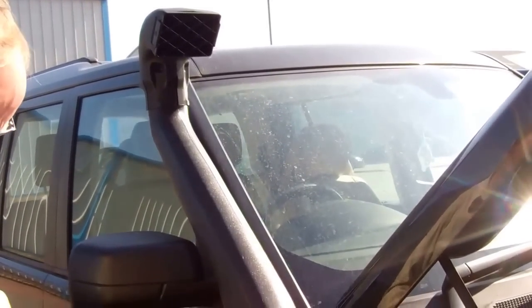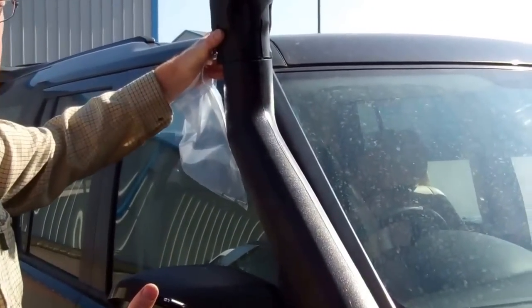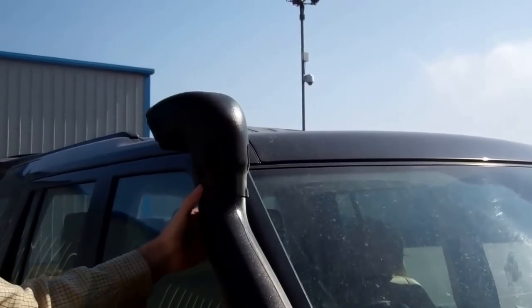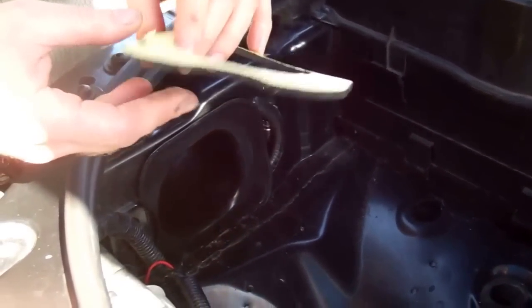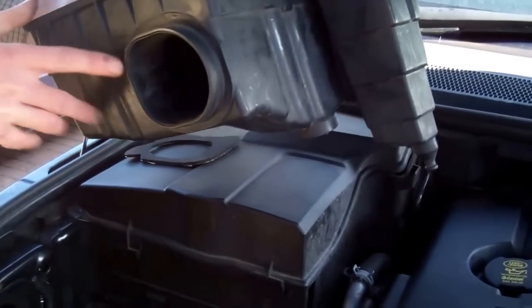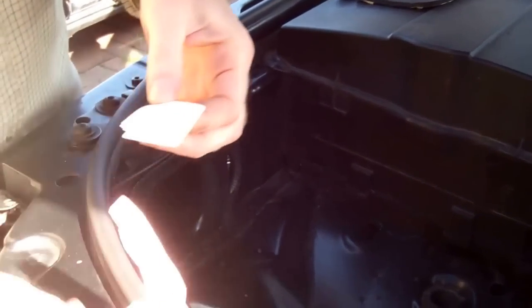Now the air — let's talk about the top snorkel. In the kit you've got a black hose clip, colour coded, that goes on top. There's some debate about which way to point the snorkel: you get a ram air effect pointing forwards, but some people say you get dust and water spray, so serious off-roaders point it backwards. The air comes down through the tube and out to the end of the elbow fitted here. In the kit we've got a gasket and we need to achieve an airtight seal between the elbow and the face on the air box.